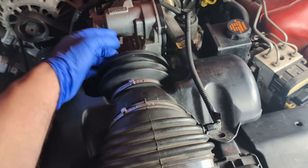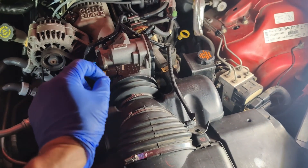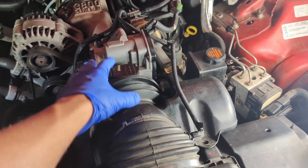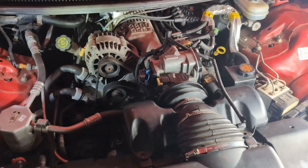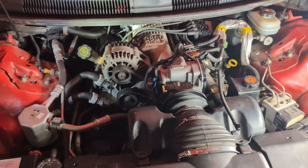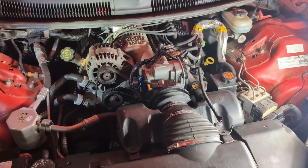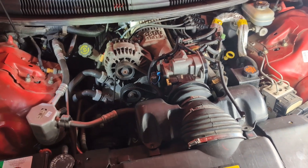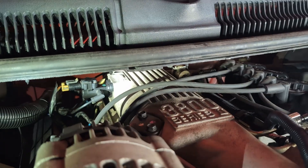When I cleaned my mass airflow sensor — which is right here, all you have to do is pull this off, pull it out and clean it — but there's also a screen inside right before the throttle body. You pull it out with snap ring pliers; there's a snap ring around it. When I pulled that out, there was fuel all inside my intake and inside my intake manifold. Guys, if your car is running rich and you've got fuel up there, the problem is probably the fuel pressure regulator.